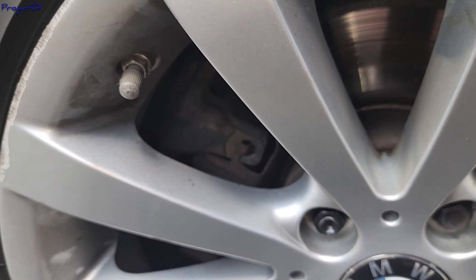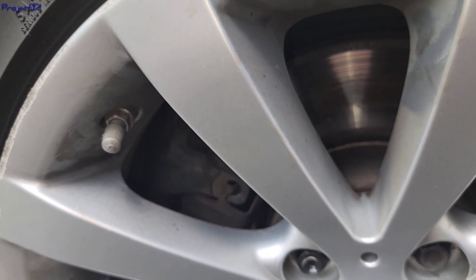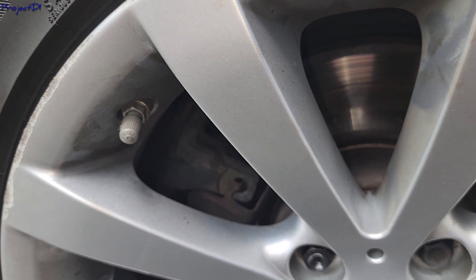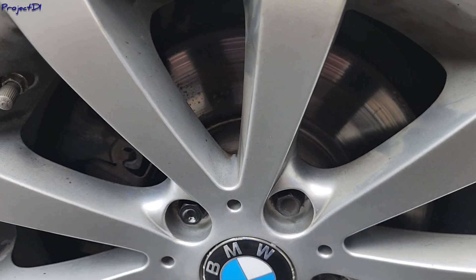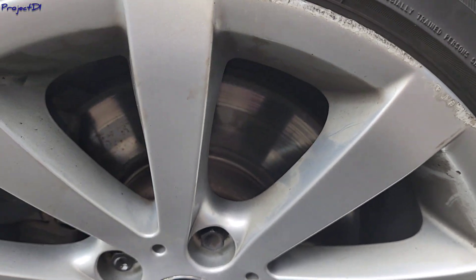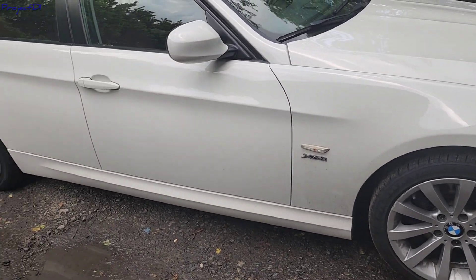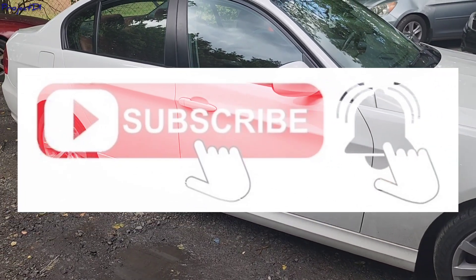In most cases when you do that to a brake pad, you destroy the brake pad itself. We'll see — maybe we can grind that surface on the brake pads to save the customer some money, but it's not a guarantee. It may work, it may not, and then we'd have to take the wheels off again and install new brake pads. We'll figure out a decision with the customer. This is why you need to replace rotors and brake pads altogether when servicing German vehicles. Thanks very much for watching — please like and subscribe, see you in the next video.